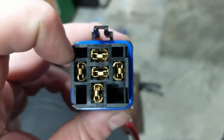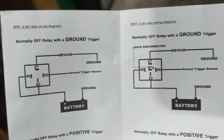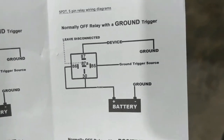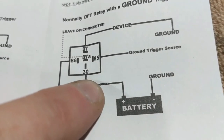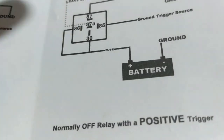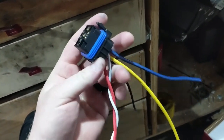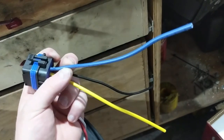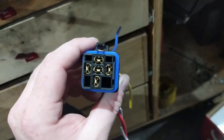So it looks like this down in there — you got five slots and I don't know which ones to use. That's when I go and turn to this little booklet right here. I can either use the top left or the top right. This wiring diagram is a little bit confusing, but 30 and 86 are the terminals you want to use. If you look at the inside of the relay, they're all labeled deep down in there when you get them in the right light. My red and white wire get joined together, my yellow is not used, my blue is going to be my 12 volts to the transbrake, and this part right here is what's going to ground it. Pretty simple, really.